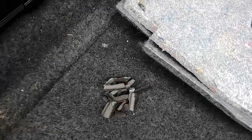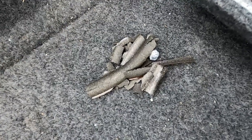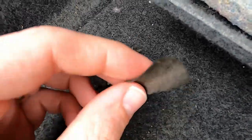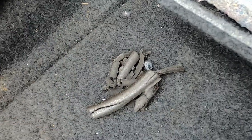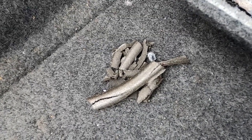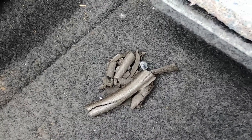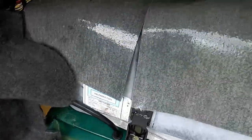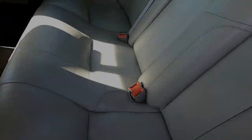With a little digging I discovered this foam right here. My worry was that the speaker itself was damaged, and doing a little research it's starting to look more and more like that's the case. You can see it has a semi-circle shaped arc — I'm pretty sure this is the foam that connects the cone to the outer ring of the speaker body. I have yet to remove the speaker to confirm, but there are repair kits available. This is a bit of an odd speaker to find, but from what I understand they're not super expensive, so I'm going to look into doing a repair of the speaker itself.